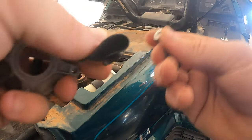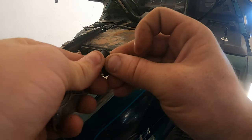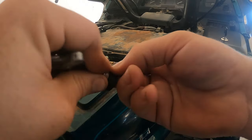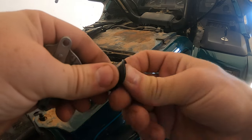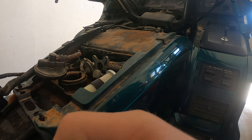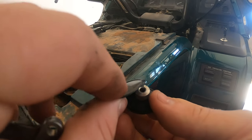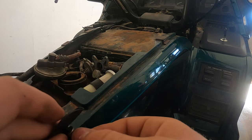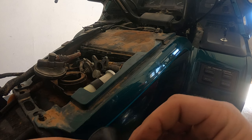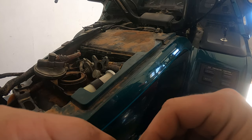I'm trying to be as careful as I can taking that top part off because it didn't look torn or have any holes I could see. So in the future, if I had to reuse one for one of my personal bikes, I might try it — if it'll save me from buying a rebuild kit. But with rubber parts, I'm always iffy about reusing them because they get cracked and torn. There's that same little rubber nipple that goes into that metal tube — again, just a little bit of saliva gives that rubber lubrication when you're putting it on the metal.